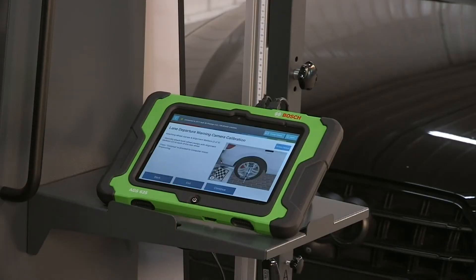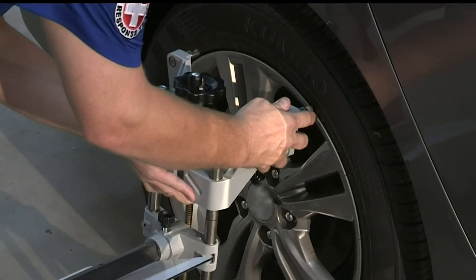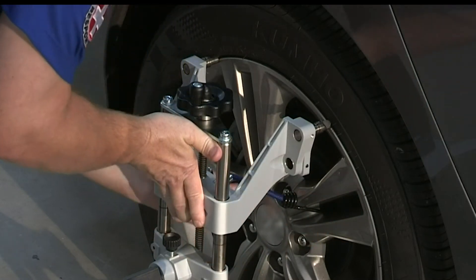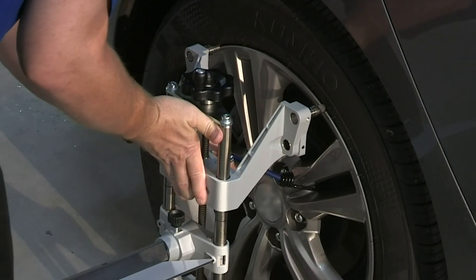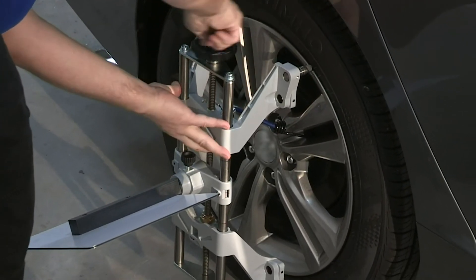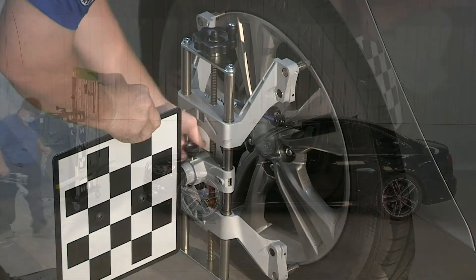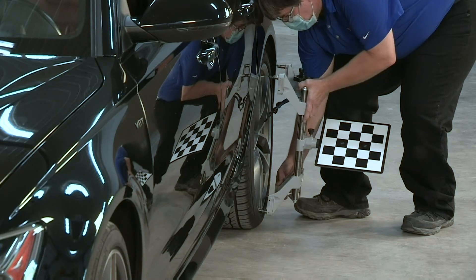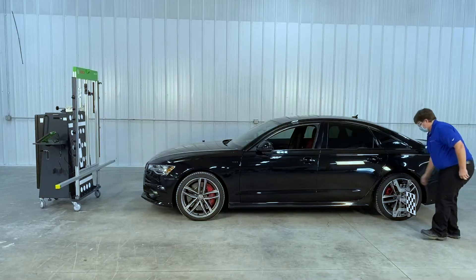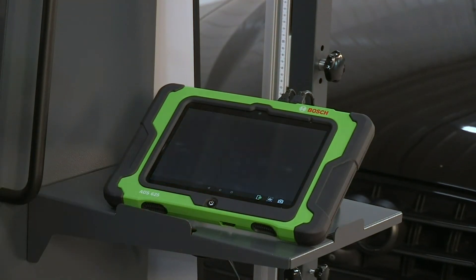Attaching wheel clamps and alignment markers — one on each of the left and right rear wheels. Place the grabbing hook at the top of the wheel. Don't forget to attach the bungee cords to secure and prevent the wheel clamps from falling off. Slowly tighten the wheel clamp and straighten the target so that it is perpendicular to the floor. Securely attach both wheel clamps with alignment markers to each of the rear wheels, then press Continue to proceed to computer vision positioning.